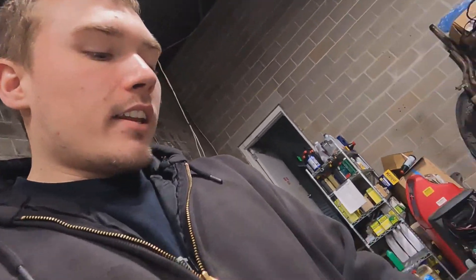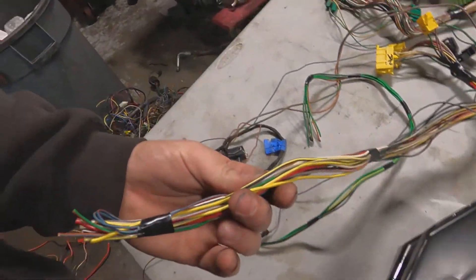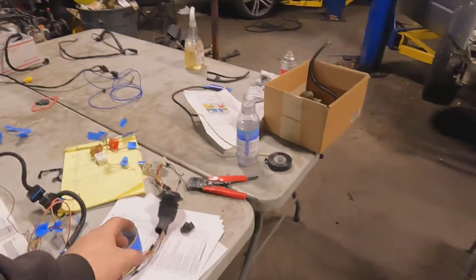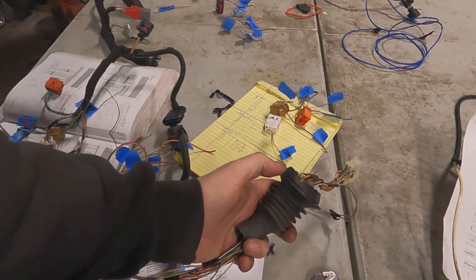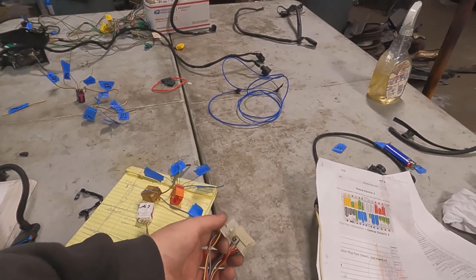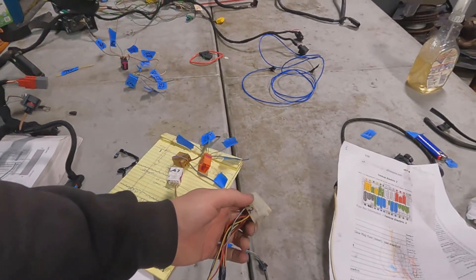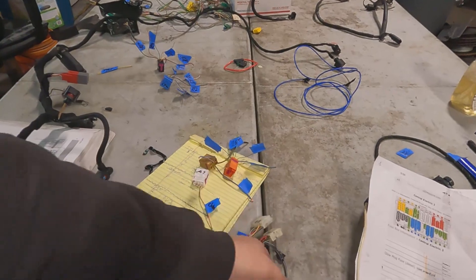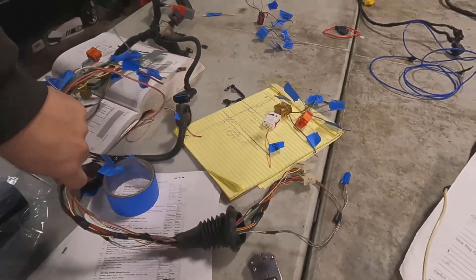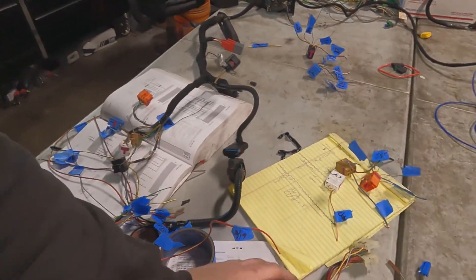You can see these are all nice and thick, so I can match the thickness of the wires. The other really good benefit of having OEM wiring harness to sort and cut out is you can usually match up wire colors — if I need a green and yellow, there's a green and yellow; if I need a black and yellow, there's one right there. That's a great help. I also have this other piece from the part-out — a Mark 3 harness that'll fit the other grommet hole. These are the last two ECU connections — engine stuff, power supplies right off the fuse box, and the gray and white K-line. I have everything labeled out here, so I'm going to put this in the car and plug it in.